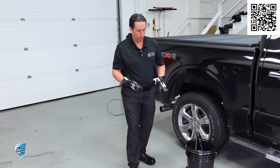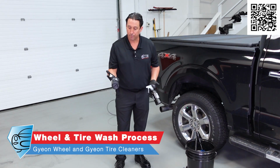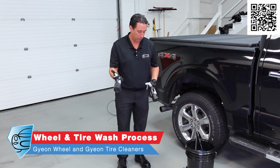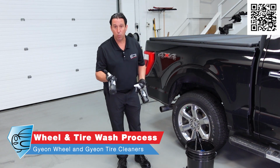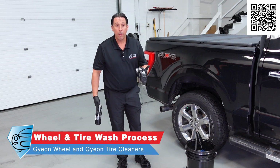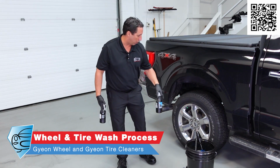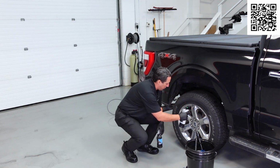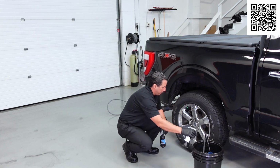Well, first thing we do, talk about our cleaning products. We're gonna use Gyeon wheel cleaner. It's great, it has an iron removing product in it. So some of the best wheel and tire cleaner we found. And then we're gonna use the Gyeon tire cleaner. The tire cleaner goes in the black rubber there. So first thing we do is we're gonna spray the product on here.